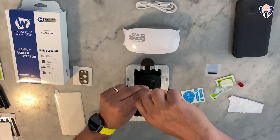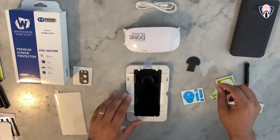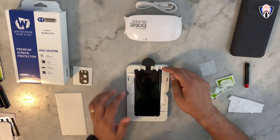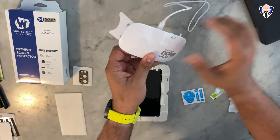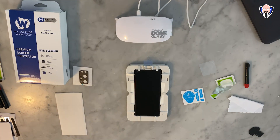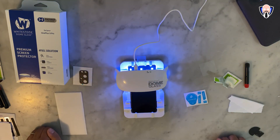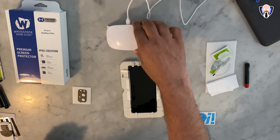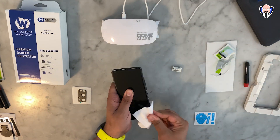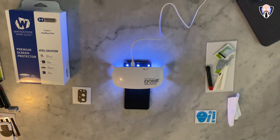It takes about 30 to 40 seconds. Once you have that done, you're pretty much 90% of the way there. Use the UV light with a power bank or direct wall connection and turn it on with the first setting, which runs for 15 seconds. I recommend doing top, middle and bottom. Then remove it from the frame, clean up any excess adhesive, and run the second stage — a double press for about 30 to 45 seconds. Run it again top, middle and bottom. Turn on your device and clean up any excess adhesive and you're pretty much set.